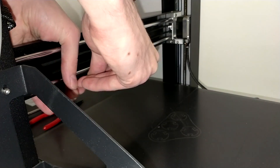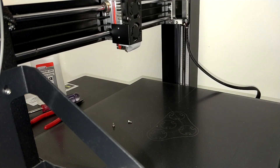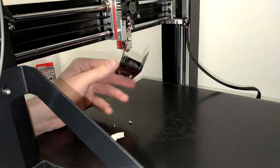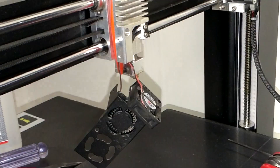We are here on my A5 — let's get started. The first thing you need to do is remove the 2 screws holding the fan mount. By removing it, you will also realize that there is a third screw from below. Once you've removed it, that removes the fan duct and the whole mount. Then you can access the 2 screws holding the hotend fan inside. Remove them and you have already completed the disassembly.